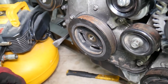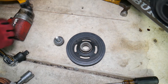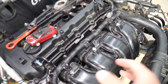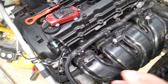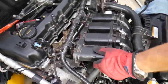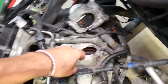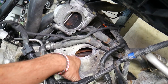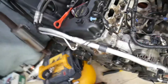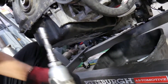It did get loose, so we can go ahead and pull the crankshaft pulley out — just like that. If you want to see the video on how to remove the intake manifold and engine starter, we have it on the channel. We removed the intake manifold and engine starter so we can show you where to install the special tool. You insert it right here where the engine starter was — it goes on the flywheel, right there, into the teeth of the flywheel, so you can securely remove the bolt.